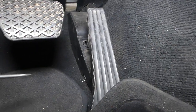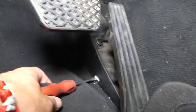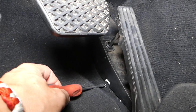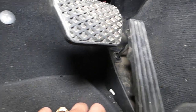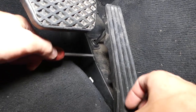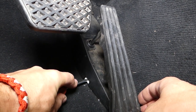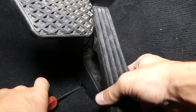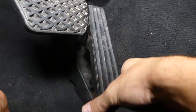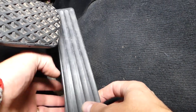I'm going to get a second person to hold the camera so I can work. Now right here there is one white clip. This white clip — you will need to hold that clip and push it down. Push down, not in, not up, because if you break it, you're done. You need to push it down. While you're pushing it down, I'm going to fold the carpet here a little bit so it's not in the way. Push down, and at the same time start sliding the pedal out. It will get stuck a little bit, but eventually it will come out.